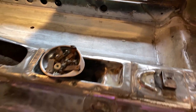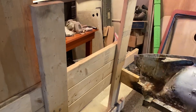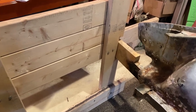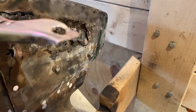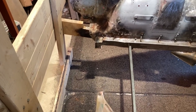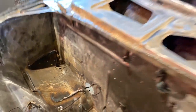A lot of work — a lot more to go. Luckily the roof was fine; they didn't do a dumb sunroof cut, so I didn't have to do anything with the roof. The core support is going to be a pain — it was a ton of work taking the old one out without damaging it too much. I still have to fill in some holes and weld them up, but I left these little ears here as a reference point so when I fit the new one I can line everything up and make it straight.